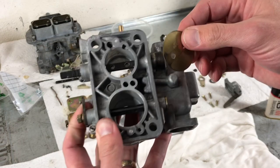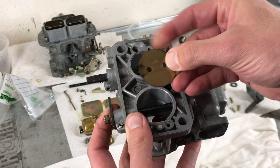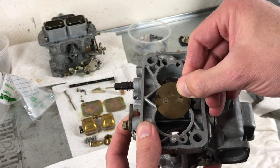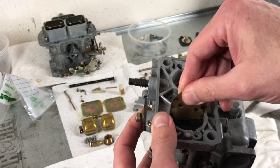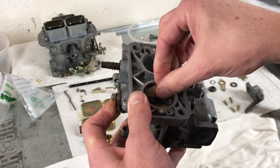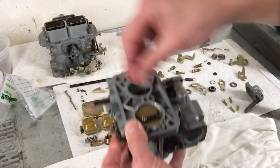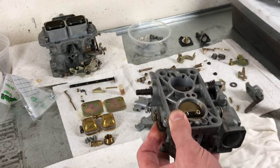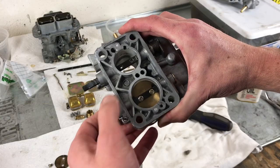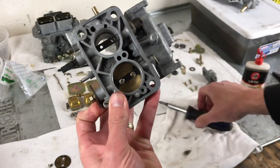For the throttle plate, this will open this way. You'll notice there is a marking of 78 — we're going to keep that on the inside of the body. You can pick up that 78 right here by my thumb. Just keep it perpendicular to the body, and then once it goes in we're going to get our screws, place those in, and lightly tighten them. We did that finger tight — you want to make sure that the plate is fully closed and that there are no gaps showing on the sides.